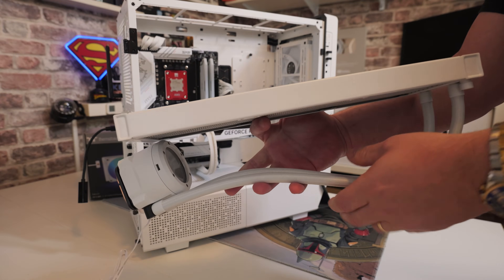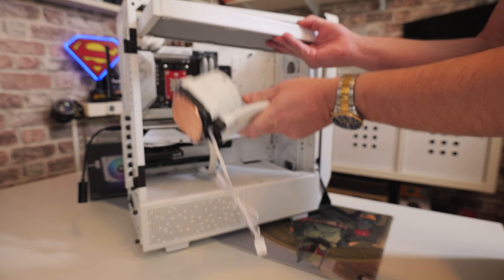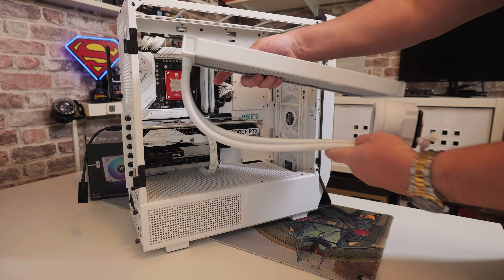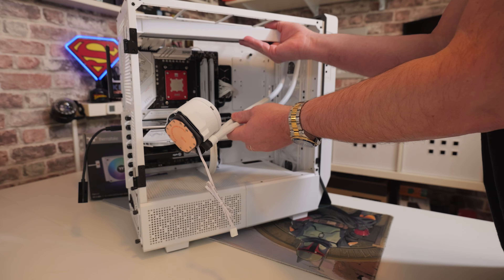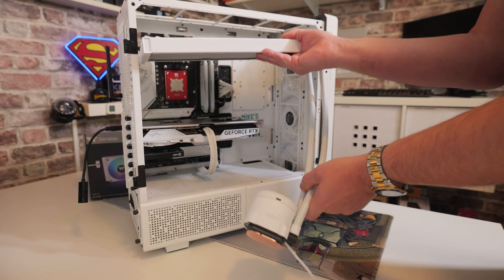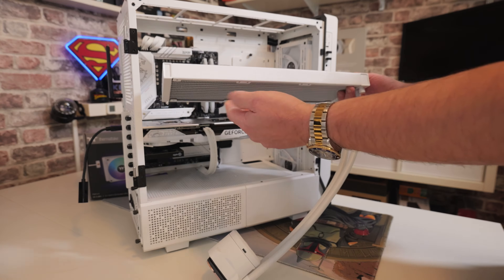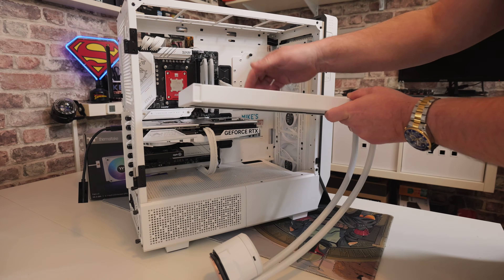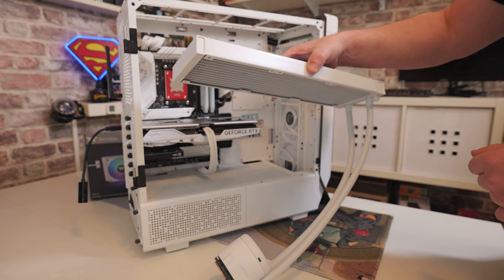Before we actually start, it's probably worth taking a look at your radiator and doing a kind of loose fit into your case to work out roughly where things are going to go — where pipes are going to lay out, whether you want the pipes going to the left or to the right. In this installation we're going to be doing it with the pipes towards the front of the case and then the cooler twisting round towards the front. We've got a routing section up in the top corner, so I'm going to leave the termination for the last fan at that end so we can route the cables through the back nice and easily.